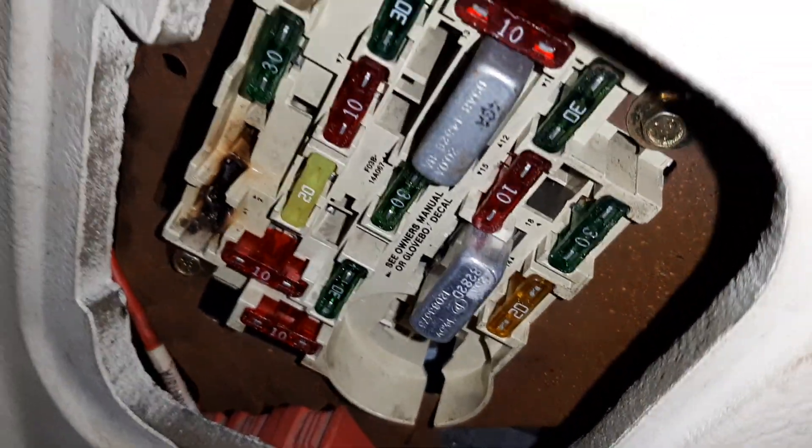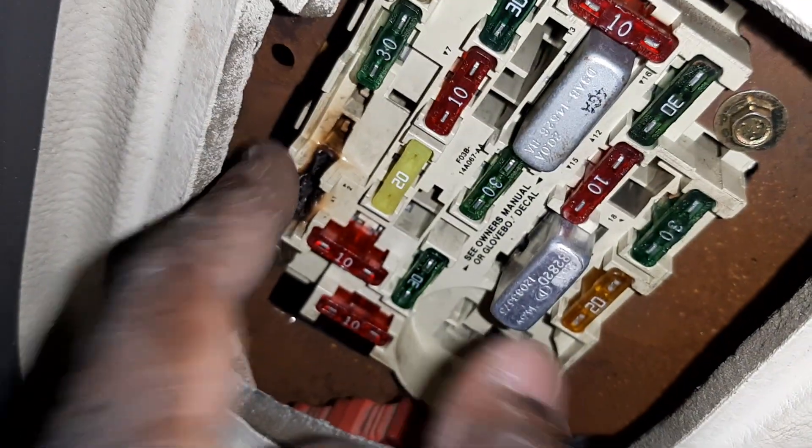This was burned when I bought the car. What I did was I took this fuse box out and everything here, cut the wires that were connected to this circuit, and just rewired them to this right here. So now we've got our blower motor, heat and everything works.